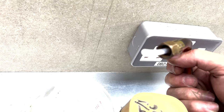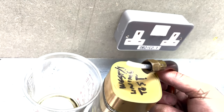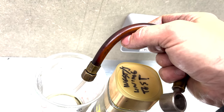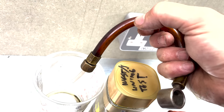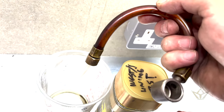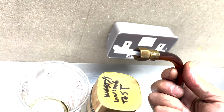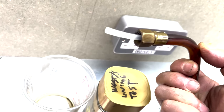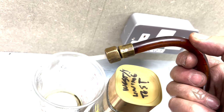The second thing is to make sure you keep this little tube in position, because as it starts to harden, if there's any blockages in there, you want the epoxy to just keep running out so that you don't block anything. And also, most important, is you don't get any epoxy on the threads. By putting the tube on the inner hole, the epoxy runs along that tube and not onto the threads.